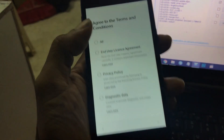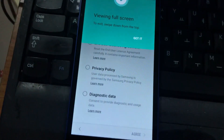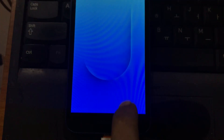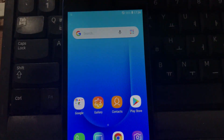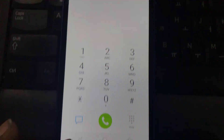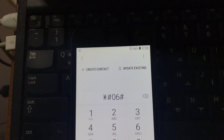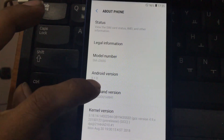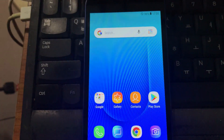It's the touch — fair. Now click Accept All. Now it's unlocked! But it has no signal and no IMEI. No signal and also no IMEI — not working. So we want to do another thing for the unlock. Don't worry, it's very easy. This is a soft error because we didn't flash the modem file.